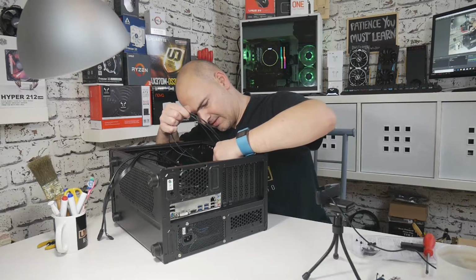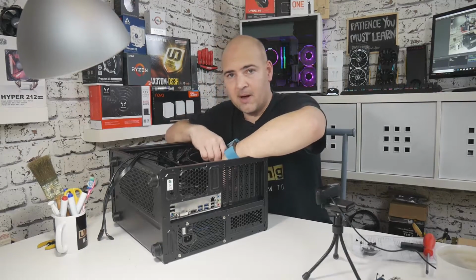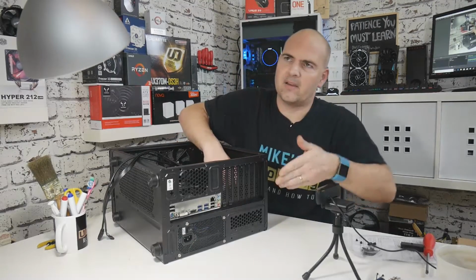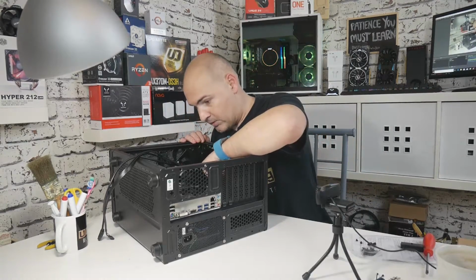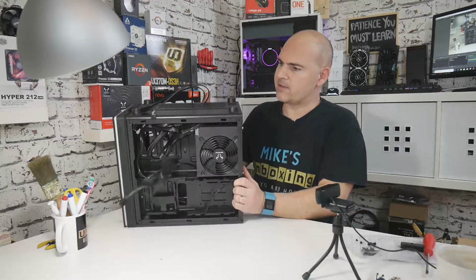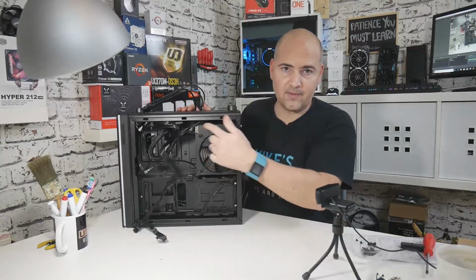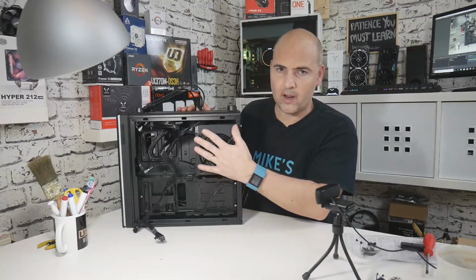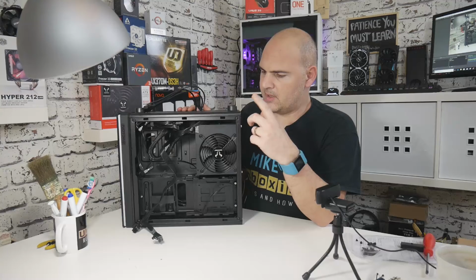Remix asks, is that a standard ATX PSU mounted version? It's a standard ATX power supply, but it's mounted that way up, so rather than being flat, it's the other way round. Which is actually a really cool idea, literally a cool idea. When the side panel's on, there's a ventilation there with a magnetic filter. So that's going to pull cool air in from your ambient temperature, and pull it out the back there, which is good for two reasons.